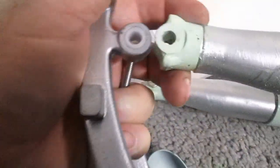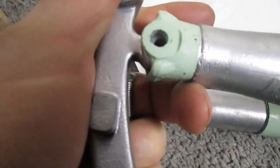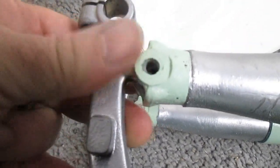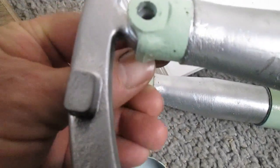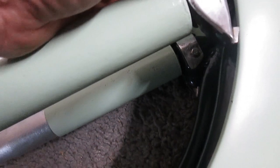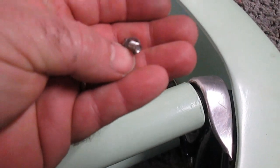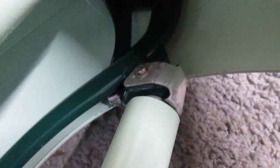This little pin goes on next — push it down over the bar and down through the bottom rubber, then it gets installed like so. This other rubber and the cap go down on top of it and then the nut. That's the other rubber attached and the cap on top. I've just attached the nut on top there and tightened it up. There's actually a special pin that goes through here but I'll have to order two of them — I can't find them. For the moment I'm using a 6mm bolt just to hold it in place, and a nut on the end of it. I must install this cover which covers over all this, and it's attached with a 5 by 6mm bolt at the rear end.